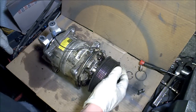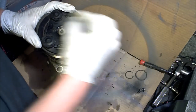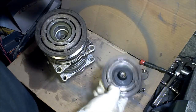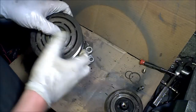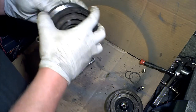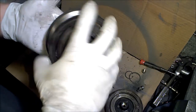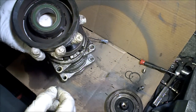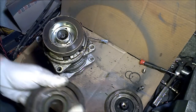I pre-removed some parts to make it quicker. First, we start out at the clutch — there was just a single bolt in the middle, and then the electric clutch plate comes off easy enough, just pulled right out of the center. Then there was a snap ring, and this is where your main bearing rides. If your clutch bearing goes bad and is making a lot of noise, it's this bearing right here, and it's pressed in.